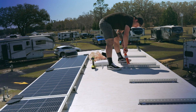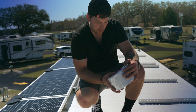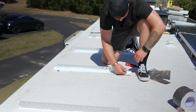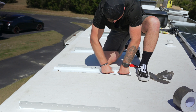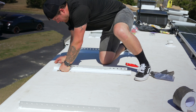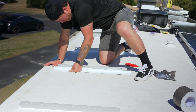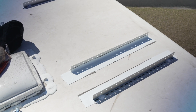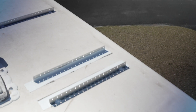It really does a good job of getting in the cracks. Coming behind with this RV sealant tape by Wallach — I'm going to peel this back so you can see it better. I don't want to cover up those holes because I need them for when we do the tilt. I'm just going to smooth this out and make sure the tape gets into the seam where we put our other sealant, laying flat, nice and tight, working out all the wrinkles. There's no way these mounts are coming off this roof — we just have to wait for the sealant to harden now.